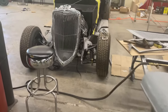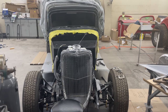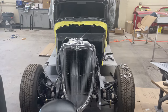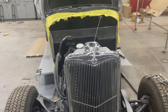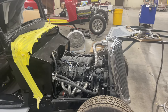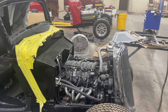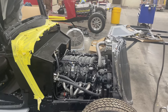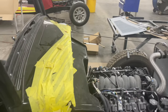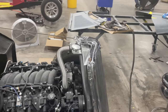I'm going to go ahead and put the hood up there, line it up the best I can, and make sure it's centered. The grille shell looks to me like it's leaning a little bit to the left, so I'll get that straightened up and make sure I get my side panels on with everything looking good before I start doing the welding. I still want to put a bigger backbone brace in the back of the hood so the lines along the edge fit good, and when you shut the hood down it feels like a solid hood. I may do the quarter-inch rod thing behind it too.